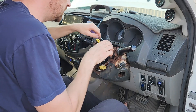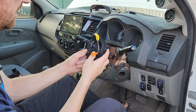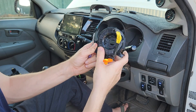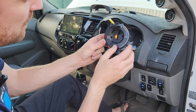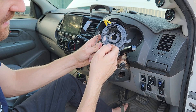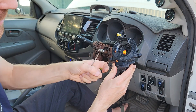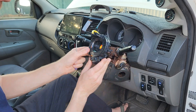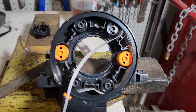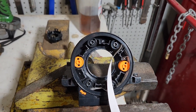There is one more clip at the top. I've taken the top shield out to have a look — just got to get under it. That's your three clips. Two plugs and that's it. They have a number 5 on them for five turns and a little window that will tell you when they're centered. This one is cooked, but the replacement one has a little window with an orange indicator so you can see that it's centered. When you get a brand new one it'll have a locking tab to make sure it's bang on center — you hook it and break it off. It is designed to break off. That's the inside of the old one — it's actually broken right there. It winds around these wheels and that's your clock spring. Pretty simple but easy to break.